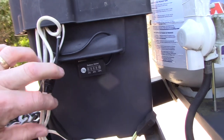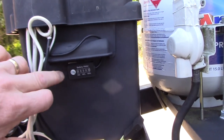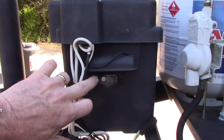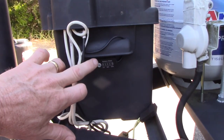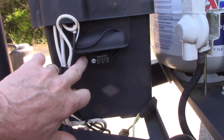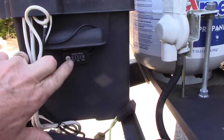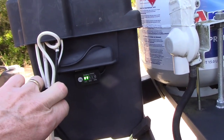A-Liners don't come with any kind of a battery gauge or battery minder — at least mine didn't. For about 10 bucks on Amazon you can buy one of these. You can see it's just really super simple to wire up — one wire to the positive, one wire to the negative. You can route those wires under your cover so it's all out of the weather, and you can see where I positioned mine under this handle here so it stays out of most of the water. We're dry camping right now and I've got about three-fifths of battery.